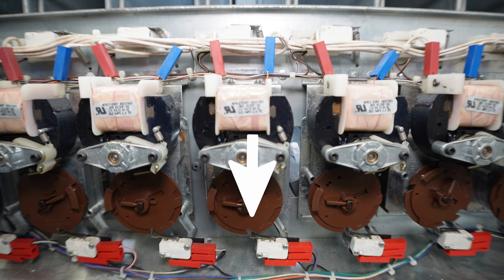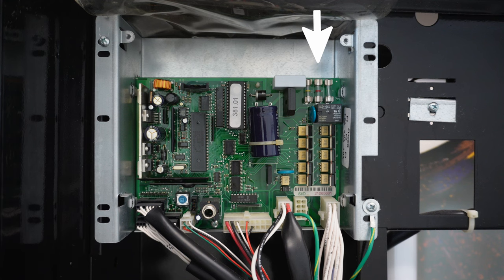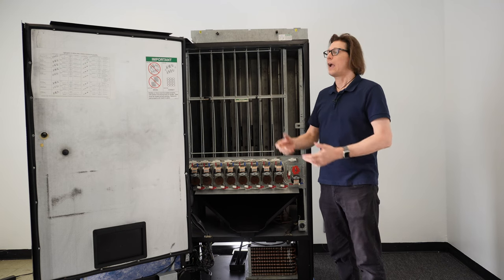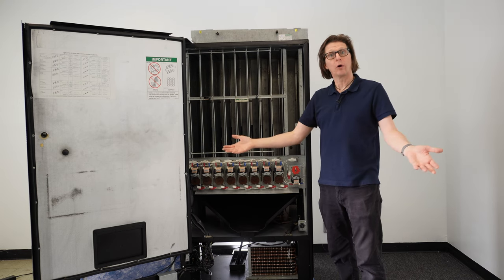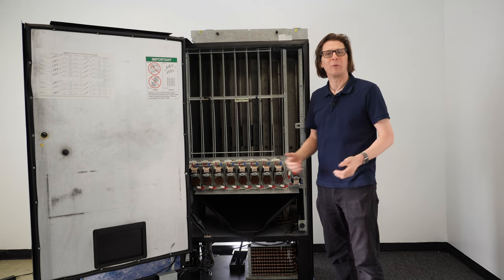You check to make sure that the home switch on your motor is in its home position, as well as checking your motor fuse for the SCD control board is not blown. And you're getting one, two, three, or possibly all your selections saying sold out. Where do you look at that point?